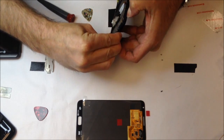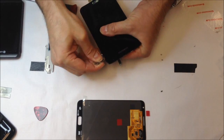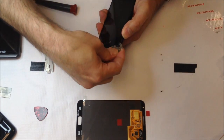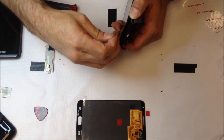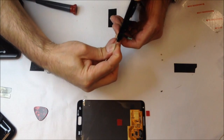Do not wipe the surface clean before you put the new lens in, because it's very important to keep that conductive paste intact. Otherwise you might have problems later on when you try to use those buttons. I'm prying across the top here. This video is in real time — I wanted you guys to get an idea of what it actually takes to get into here, so I'm not time-lapsing very much.